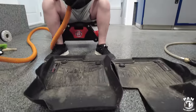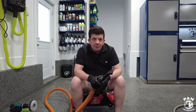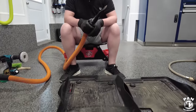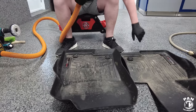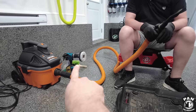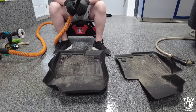So we removed the floor mats — they look appropriately disgusting, having been through the Canadian winter. So Andy is going to take care of them. First, start by vacuuming the loose dirt and grime. Then rinse the floor mats. After that, use the floor mat and cargo liner rejuvenator chemical. Use the drill brush attachment to agitate everything. Rinse again, then let them air dry, or use a car dryer to speed up the process. Go ahead, Andy — start doing the job.